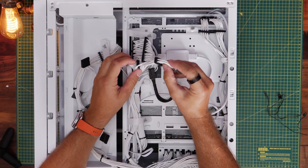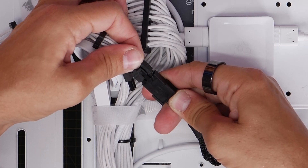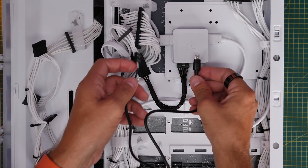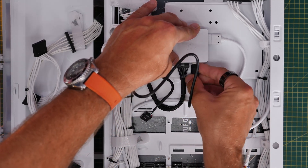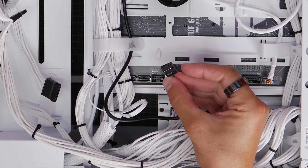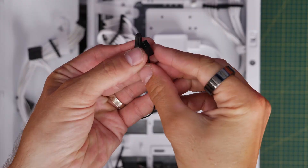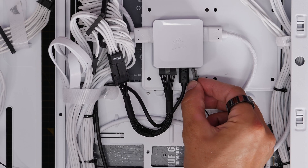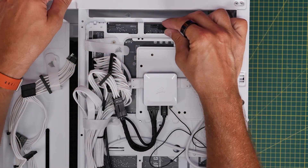Plug in the additional cables, making sure the PCIe power cable is in place and also connecting the controller to the motherboard with the USB connection. This is a rear-connect motherboard so it connects slightly differently — the USB ports are at the back of the case — but the same logic applies. Make sure the USB is fully connected both on the controller and on the USB port itself. Also don't forget the additional cable — I'd recommend plugging it into the CPU fan header on the motherboard, which on this rear-connect motherboard is at the top row.